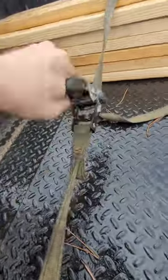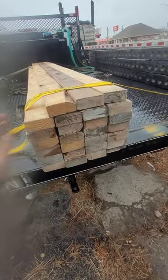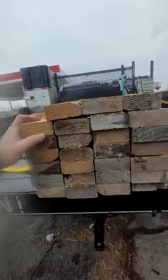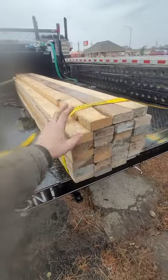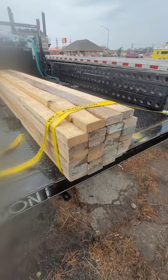Let's go ahead and tighten the front. The reason you need a noose on this is sometimes these loads will have gaps in between them, and one of these boards can come flying out and go through somebody's windshield. You cinch it down like this with a loop over the load, and you don't have to worry about that.